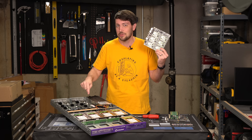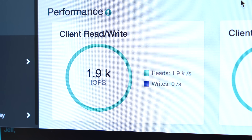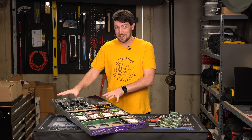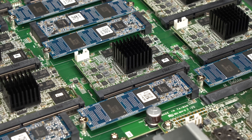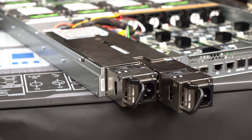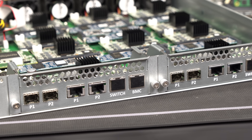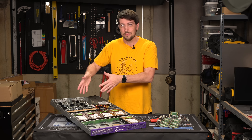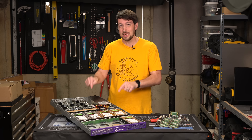I was able to take this storage appliance, built with 8 individual ARM nodes — very much like the 6 on the Super 6C — and built a bulletproof Ceph storage cluster on it. But this thing goes way deeper than my Pi cluster. Each ARM node has 4GB of RAM and a 128GB SSD. Up front there's a full hard drive bay, one for each node. Over here, dual redundant power supplies. And back here — this is my favorite part of this whole box — there are dual redundant network switches connecting everything together.